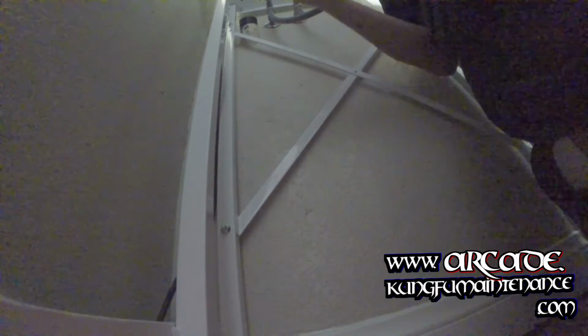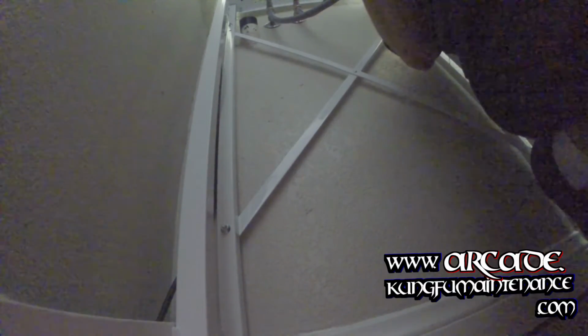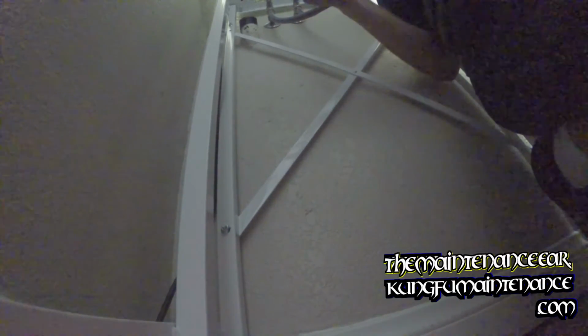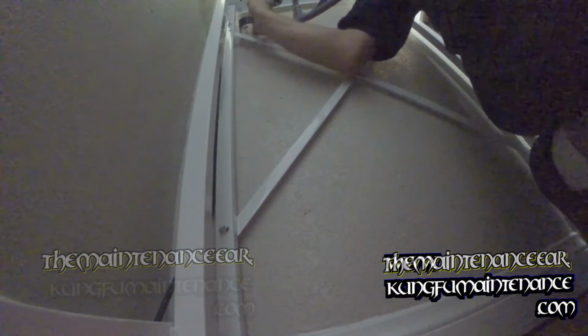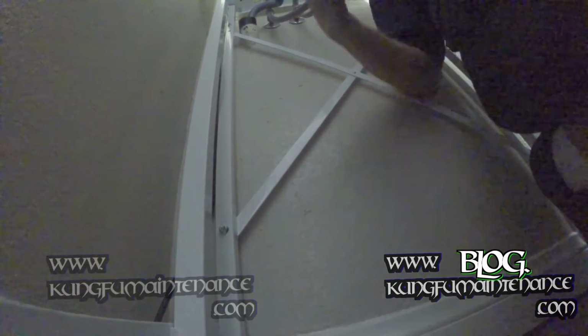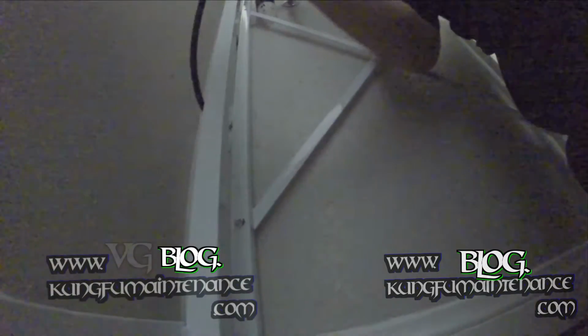Good, good. And then on our drain line hose, we've got this holder here. So just going to use the holder. It allows us to anchor the hose. Definitely a good thing. These can push their way out of the drain, and we want it to be anchored. So there's that. Okay. And our dryer, I'm going to go ahead and plug the dryer in.